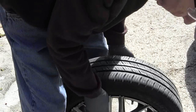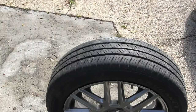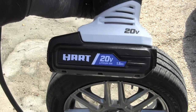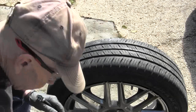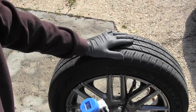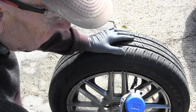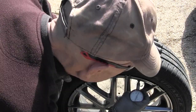What I'm going to do is fill it up with air to 35 pounds, and that's what you want on all four tires to satisfy the TPMS. We're going to fill it up with air. You can always take some out if it's over — if it's got too much in it. Now it's 35 pounds.